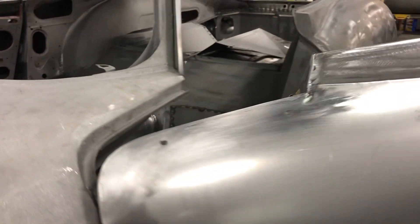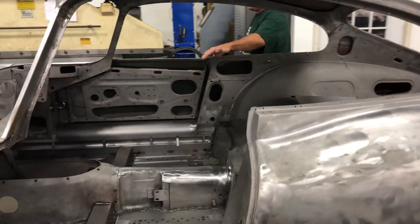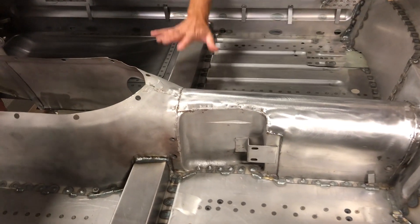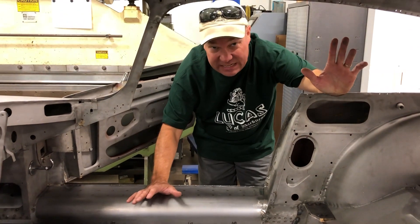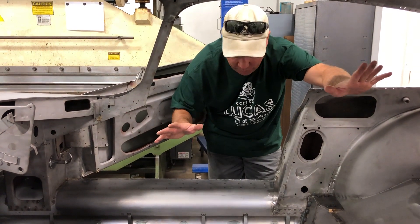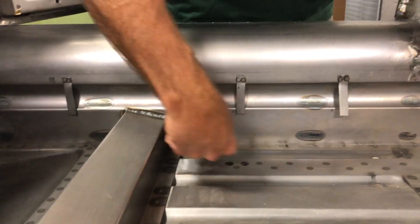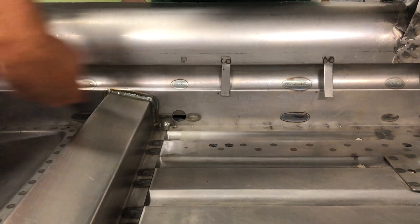Now I'm going to go around to the other side to show you what we've done on the inside. Pretty much every car that comes through here gets new floors, new inner and outer sills, new cross member. That's all 18 gauge, where originally it was 19 gauge, so it's a little bit thicker. And then this car, like all the ones we do, has our hidden internal subframe — there is roll cage strength, heavy rectangular tubing welded inside the sills along here.